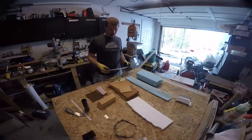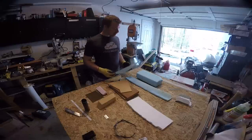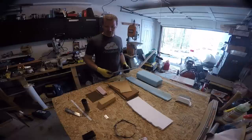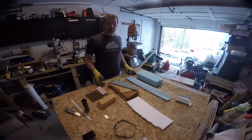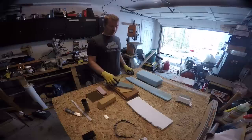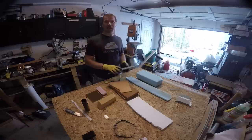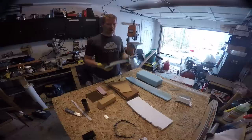I can't finish the plane — it's only a four-seater and I have five kids — so now I'm off on my next project, the schoolie, and hopefully I'll be able to reuse some of my fiberglass skills there. There are a lot of different kinds of foam. Most of the foams are used as cores, and this is what we call moldless construction. The foam itself is the mold — it's the substrate. You shape it to what you want the piece to look like, then put the fiberglass on top, and that makes your body panel.